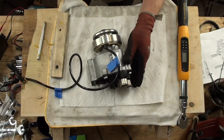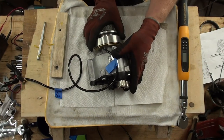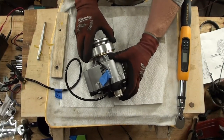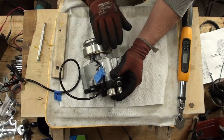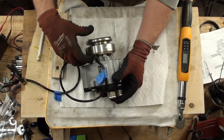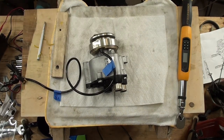I have my bench test hooked up to the power supply. Give it some voltage — there it is, that's going. I'll give it 12 volts — our pump is pumping. Then I take off the power: it disengages and now just the front turns. Because this will always be turning with the belt, and then the clutch clamps in and drives the pump when it's called for. We know everything works properly.